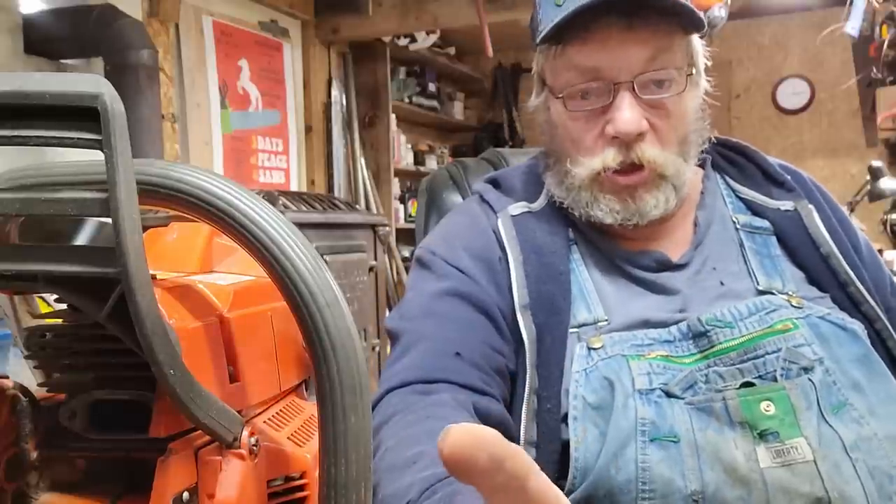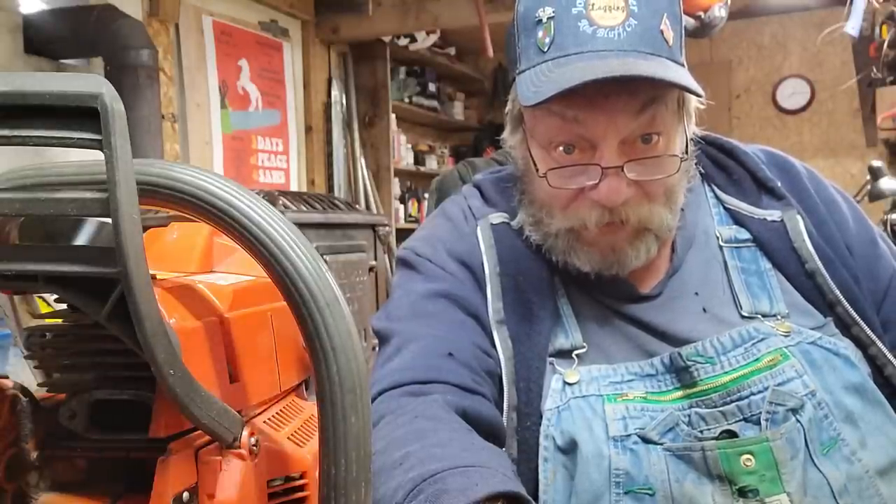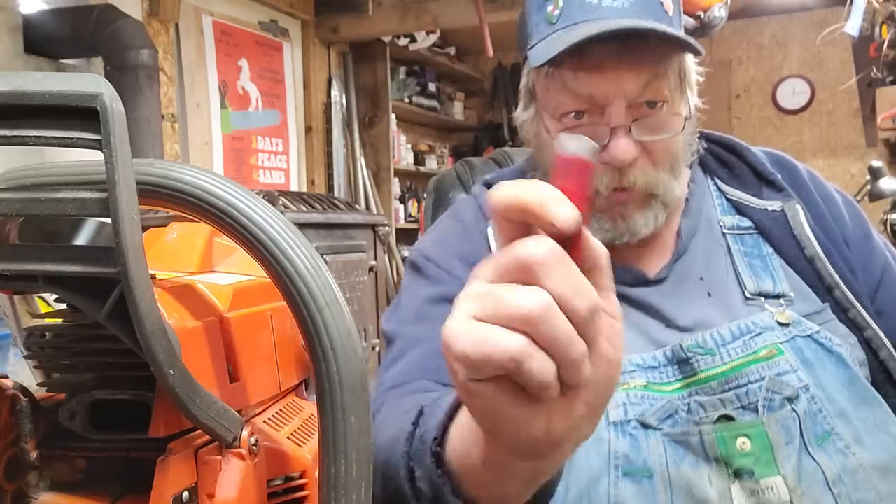This is an early cylinder and I'm really hoping it's a good cylinder and piston to work with, because I want to stay with stock bore. I'm well known for my big bores and they run like crazy good, and everybody likes them including me. But let's use stock timing numbers — let's just see how valid the moves I make really are. Let's pull out a bunch of the little tricks: number one, to keep the saw alive; number two, for great tunability; number three, easy starting, runs all day, doesn't overheat. But let's do it with stone stock timing numbers.